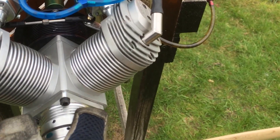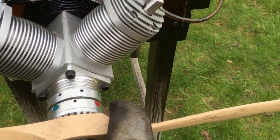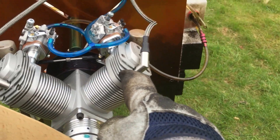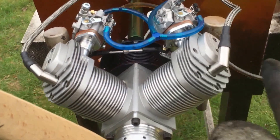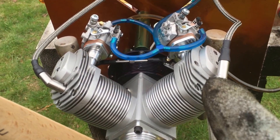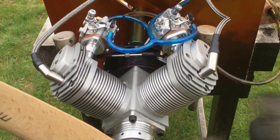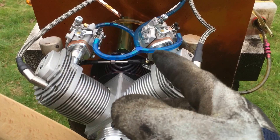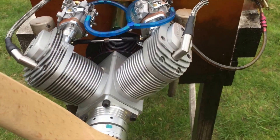So you have a sensor ring and magnet ring with two magnets. The green magnet is for setting the timing. When you're looking at the engine, you can see the cylinder on your right — I call that my number one cylinder when I'm doing timing. You only need to time this one. Get your top dead center, turn it 30 degrees or 28 degrees before top dead center, install the ring, then turn the ring anticlockwise till the plug fires or your timing device goes off, and come back by 0.5mm. That should be your correct timing set.